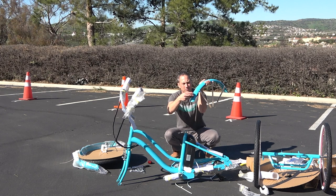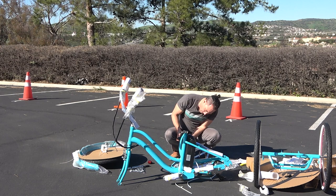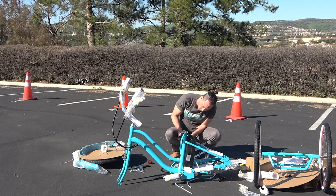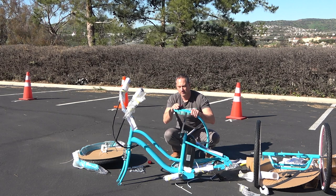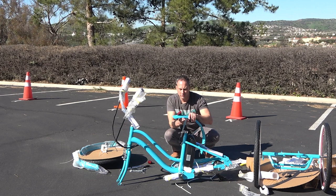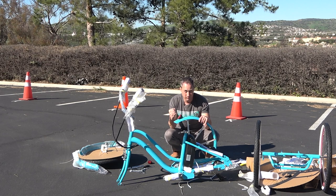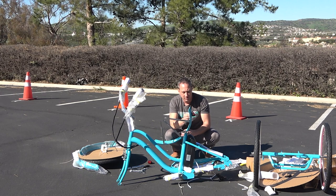When they were packaged attached to the fender, they were popping — like if you stepped on a Christmas light bulb. We were always sending these and customers were having to replace them. So the idea was just to go ahead and put them in the parts box, and ever since we've never had a problem. Just tighten that nut up with an 8 millimeter. Some fasteners need to be tightened all the way, like on a car, but on others like this reflector you just need to get them snug — you don't want to crank it down so hard that it pulls the hardware through the plastic and breaks it.